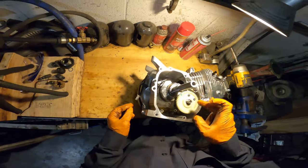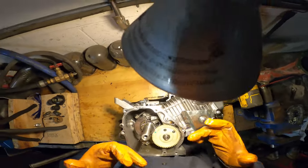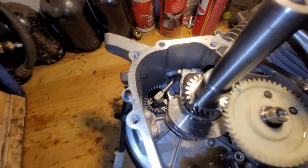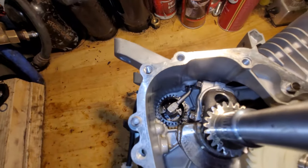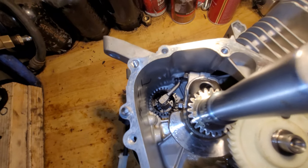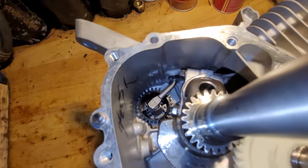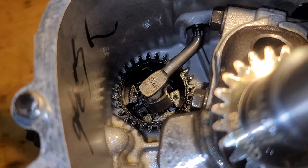Please make sure you pay attention to this plastic wheel. It's very easy for it to come out when you're pulling the cover, and that will put you out of timing. The governor wheel is this thing right there — that black-looking thing. Some of them come white, depending on the manufacture of the engine. Predators will come white, and this one is apparently black. But at the end, it's exactly the same thing, and this is what we have to remove.